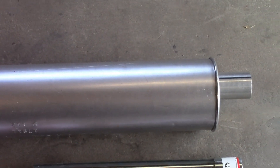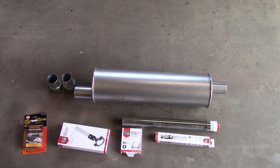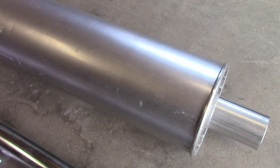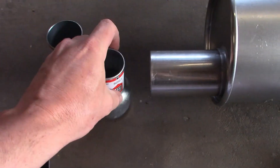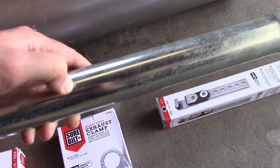Here are the parts that I bought so far. This is a cheap muffler I got off Amazon. I got this one because the outside diameter is the same as the original. I'll mention in the description below exactly what it is. The outlets are 2.5 inches, but internally it steps down to about 1.5, so I'm guessing this is probably right for my application. I got a couple of adapters from AutoZone to step it down to the factory sizes, also a new piece of 1.75-inch pipe to make the tailpipe — same diameter as the original — and a few universal mounts to attach it all.